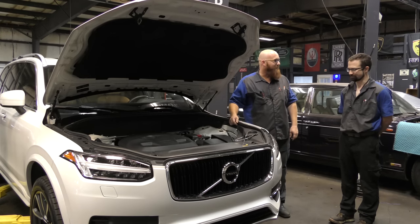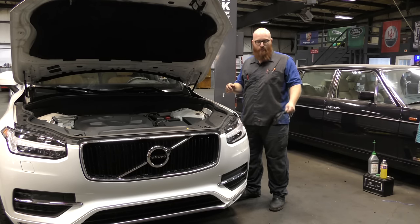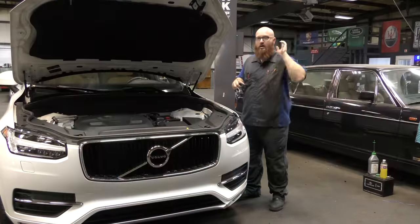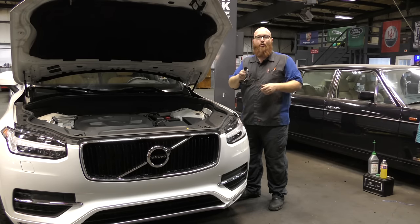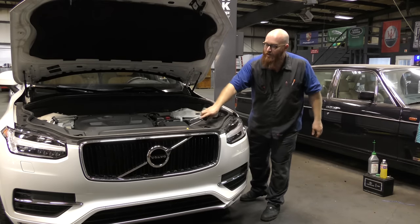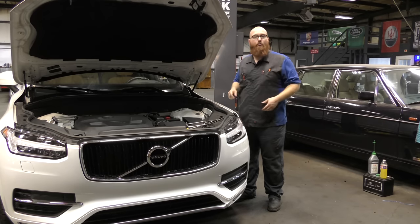When we get these few little things fixed up, this thing will be perfect. In the rear we were able to discover that the driver's side rear has a possible wheel bearing issue. We use this little tool — it's like a doctor's stethoscope with a solid metal rod at the end. It's the same principle as putting your ear on a railroad track to hear a train in the distance by listening to vibrations through the metal. You don't use this on the moving part — you set this on the housing that the bearing rolls into and you can actually hear it. You shouldn't hear anything hardly at all, but if you hear a roaring, you know you've got a bad wheel bearing. Very handy tool. We also found an exhaust leak, which is a flange gasket — we'll get that taken care of.